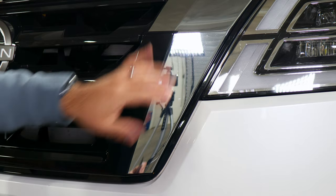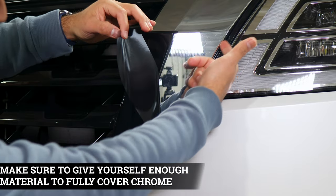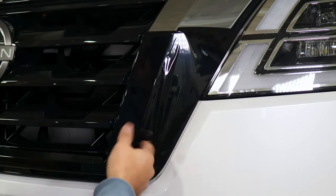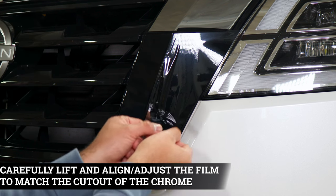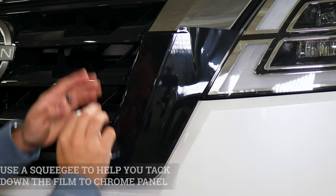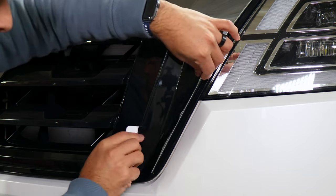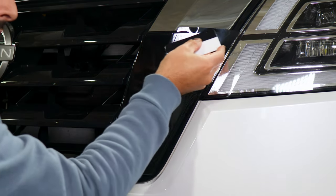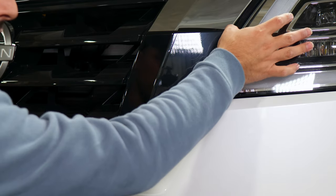Now that we've finished all the side panels, we can move on with this section. It's just making sure you align it wherever you left off, making sure everything's being covered on the bottom and you have the material to cover the chrome on this side. Place it and as you're placing it, make sure all of the chrome is being covered. You can always re-lift the film if you need to. If you need to lift it, lift it carefully and try not to crease it, then place it back down. Now focus on tacking everything down — remove all the air underneath the film, work your way pushing all the air out, and secure it as you work toward the outer section. Chrome's being covered on the bottom — perfect, everything's covered. Tack it down to the curve, apply heat just to help it tack down around the curve, and then trim off any excess material since we don't need to cover that part.